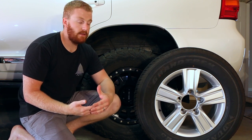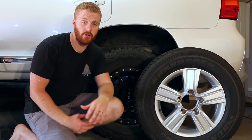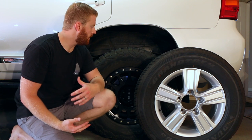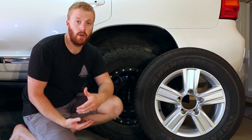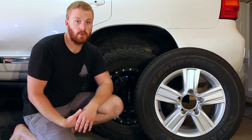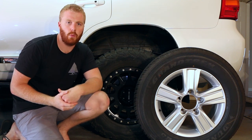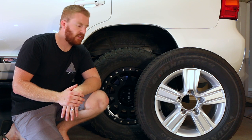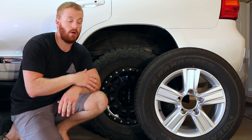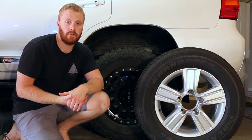The other consideration is noise. These BF Goodrich tires, just with their size and tread pattern, will be a little bit noisier than the stock tires on the road. The BF Goodrich is really good overall — they are a well-designed tire and they're only an all-terrain, not a mud terrain, so they're quite good — but there is a difference in noise. If you went to a mud terrain it'd be significantly noisier again. So even though these tires are bigger, use more fuel, and are a little bit noisier, the reason we chose them is they're more suited to what we use them for. This car is set up for off-roading and touring — these tires are strong and robust, they'll get us anywhere comfortably both on and off road. For us, it's worth the sacrifice in fuel and noise, and they suit our application perfectly.